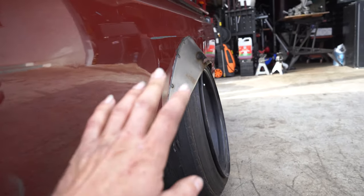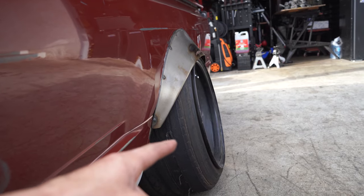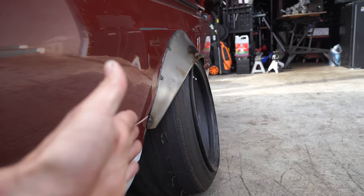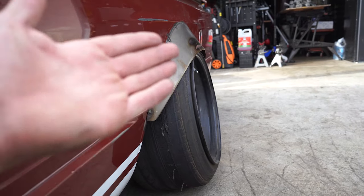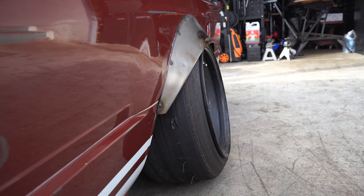Once it's done I'm not going to be rocking these wheels anymore, and I'm not going to run this much camber — I want to get as close to zero as possible. The IRS is mainly for toe and caster to help me kick out more, and I got the IRS for free — all I did was upgrade the arms.